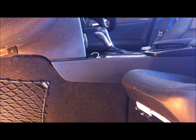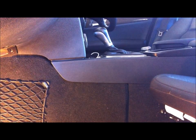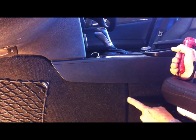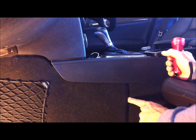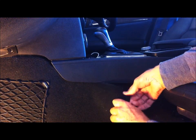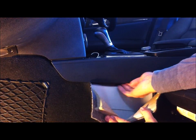The next step is to move the seat back as far as it will go. You'll see there's a joint in the carpet here. Just put your fingers under the front section and pull it out and down. Then the same with the rear — pull that out and expose the underside of the console.